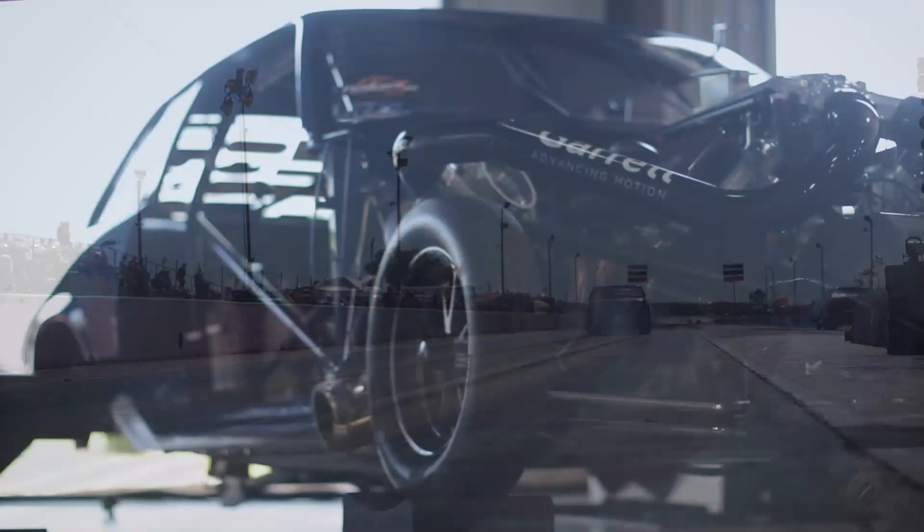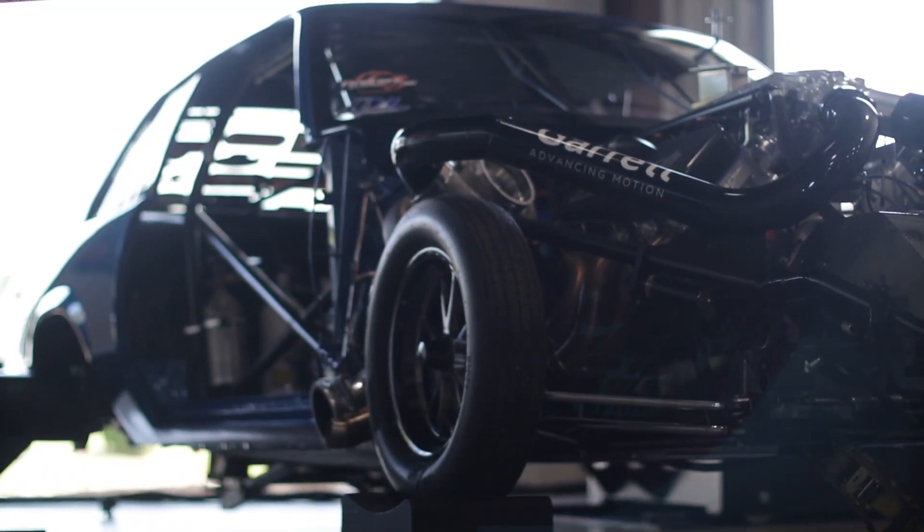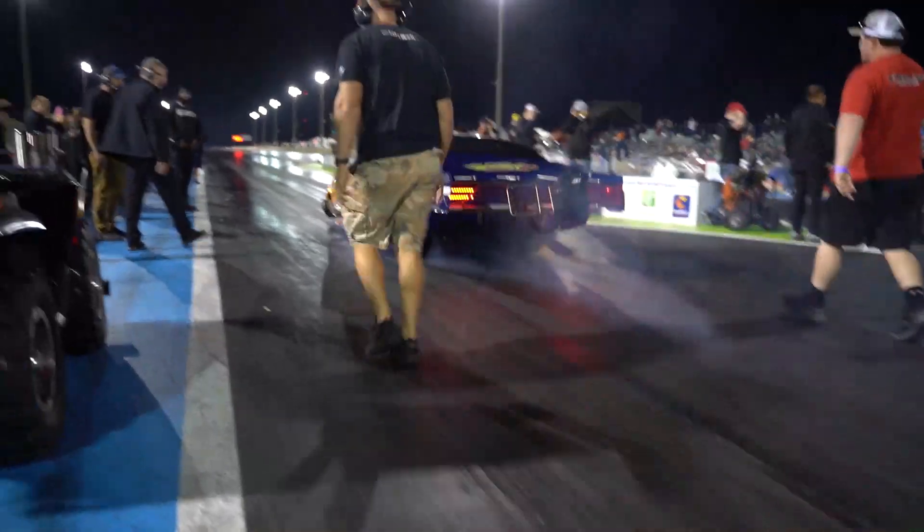After he leaves, the car does exactly what it will be doing at the track — it's going to be shifting. If you have a boost curve, it's going to do a boost curve. If you have nitrous, a progressive nitrous is going to progress your nitrous. You have pro nitrous — it's going to stage, bam bam bam, all the nitrous kits. You have power management where you have time-based timing — it will do that too. It's going to ramp the power down and come back to ramp in. Everything just like the racetrack.